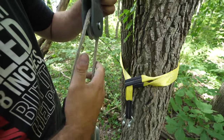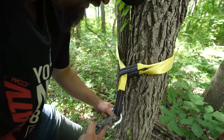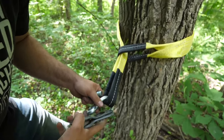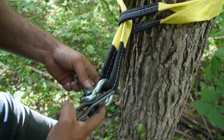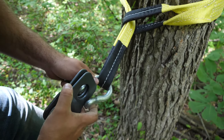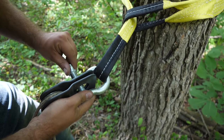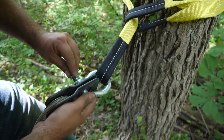At this point you should have your rope running through just like so. We'll go back over to our clevis, take our pin, slide it through both holes on the snatch block, just like that, and thread it in. We'll want to go ahead and get this tight.